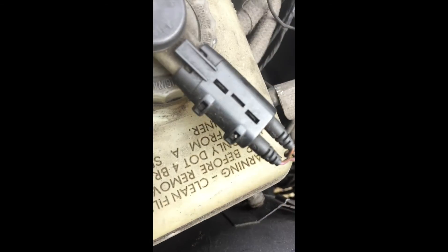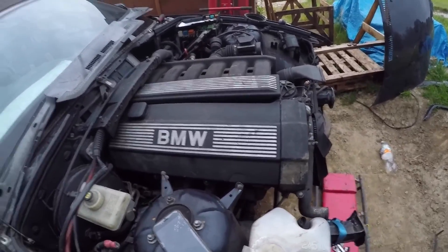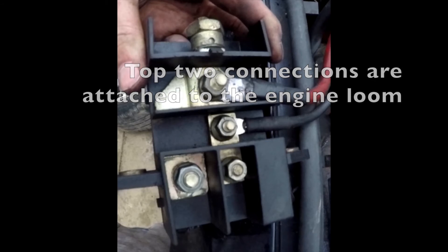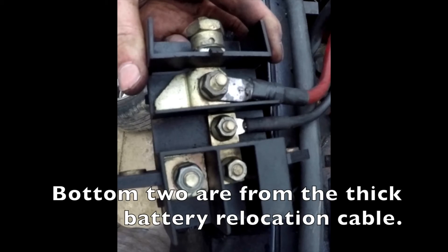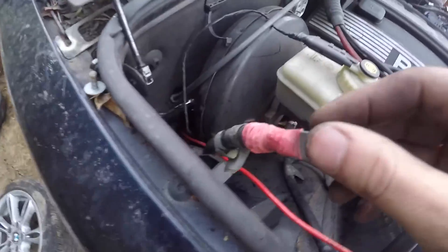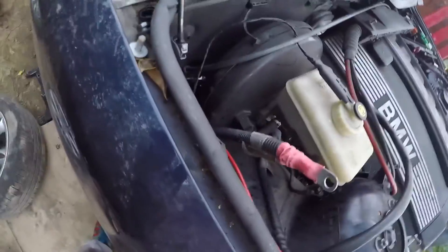Six cylinder ground. Passing the driver's side on the strap. Now the last of the wiring puzzle — it's so straightforward if you just leave the loom on the engine like I've done. You've now got a thick ring and a thinner one. Go in with the other end, leave this and then go through the terminal side, because that's going to the back. Leave this signal wire here as well, and you have to keep that grommet through, but pretty simple.